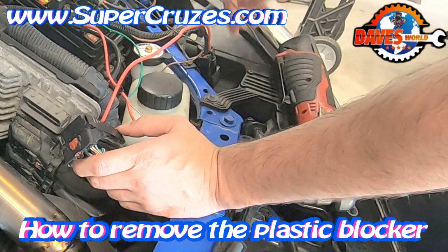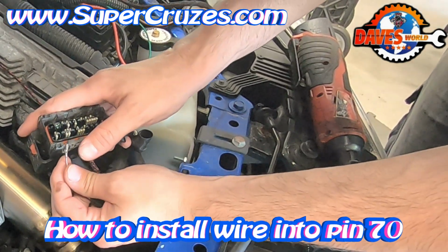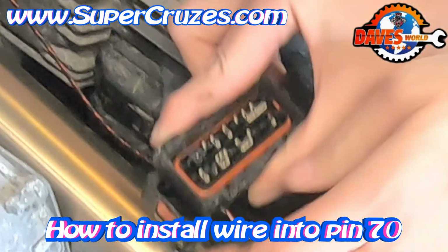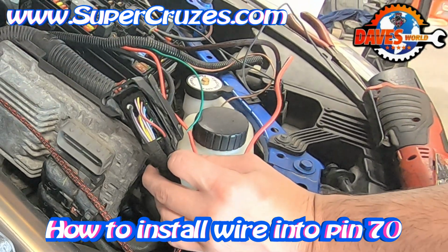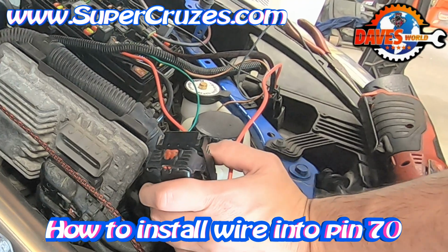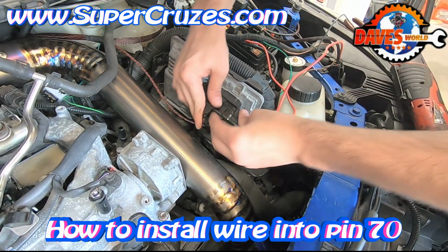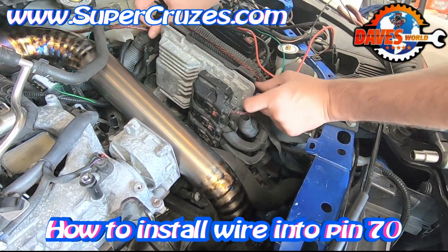And then what you need to do is you want to take the new pin, make sure it faces the same direction, and slide it in. And you want to make sure it's in all the way into pin 70. And then you want to put the connectors back on. And then obviously you can zip tie the harness out of the way. You can put it any way you like.